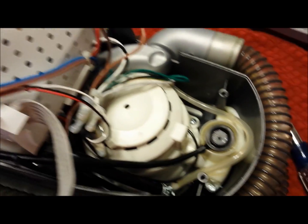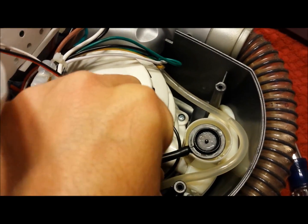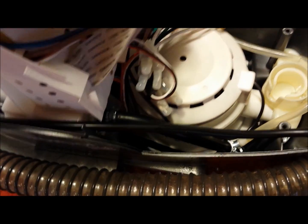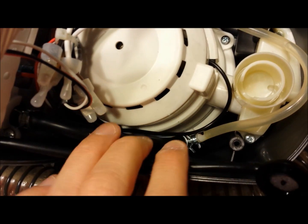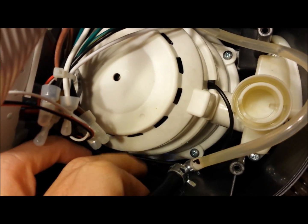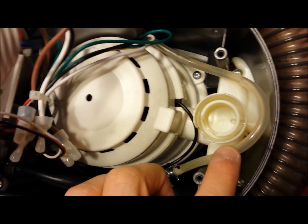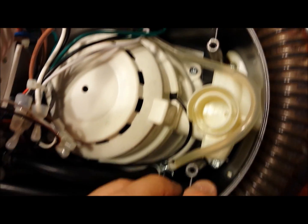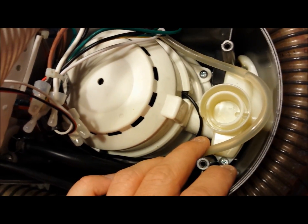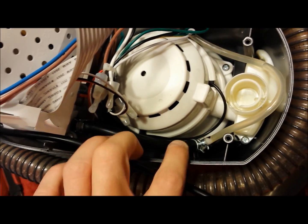This small piece is the bottom of the reservoir tank and just comes out. The black tube goes up through the pump and back out, then splits two ways — one black hose goes to the cleaning chamber, and a clear hose goes all the way through to the hose attachment. You can visually inspect the clear hose for blockages. If you're getting nothing out of both ends, the blockage must be happening before it splits at the Y connector.